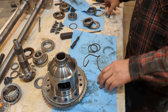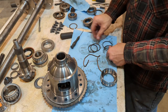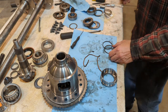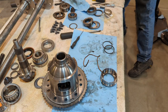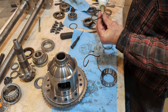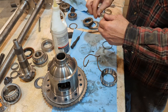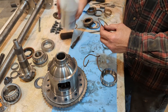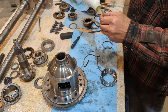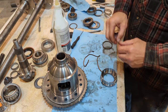Make sure that your new O-rings match up with your old ones. And also, when you go to put these in, put some gear oil right between your fingers there, slide around, get it lathered on there pretty good. That way these things aren't rubbing dry and they go in a lot easier.